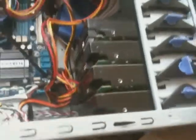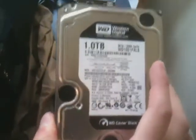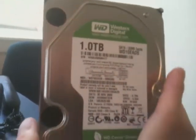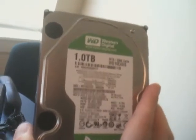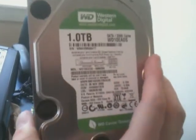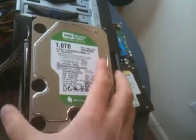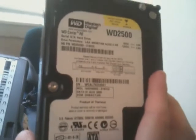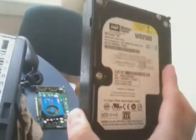I've got four hard drives here. I have a 1TB Western Digital Caviar Black — these are some of the best drives you can buy on the market today. I have a second one of those. I also have a Western Digital Caviar Green drive, which has 32 megabytes of cache. These drives say that they're 5400 to 7200 RPM — they're 5400, don't make any mistake about that. They are terrible OS drives but excellent storage drives. And this is the oldest hard drive I have: a Western Digital Caviar RE, the original RE series, it's a 250 gig drive. I've had it since 2005 and it has no bad sectors and nothing is wrong with it at all — champ of a hard drive.